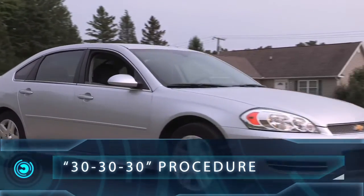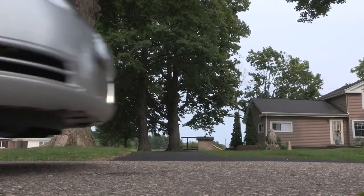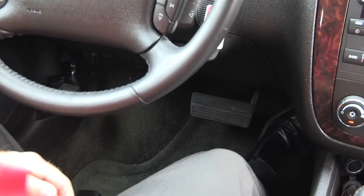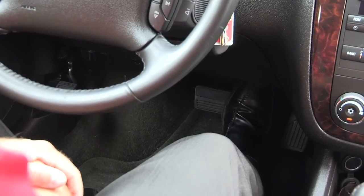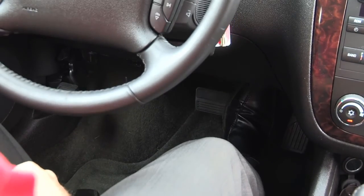If you have other specific directions from the manufacturer, feel free to use that method. The most important thing to remember is to burnish the brakes before returning the vehicle to the customer. If for some reason you're unable to complete the brake-in, take the time to advise your customer on how to do so. However, we strongly urge you to complete this for them. It is an extension of a great brake job and will only take 15 minutes to do. The burnishing process will help the brakes achieve optimal wear, performance, and noise reduction.